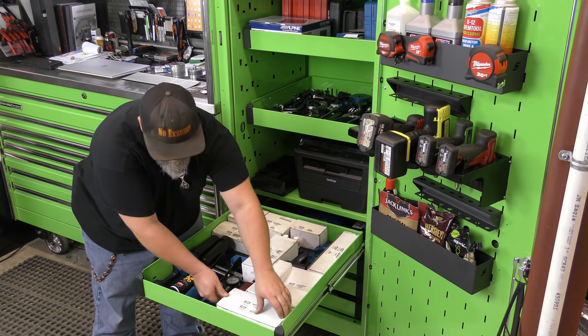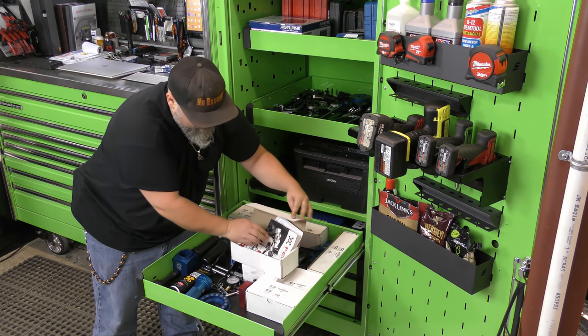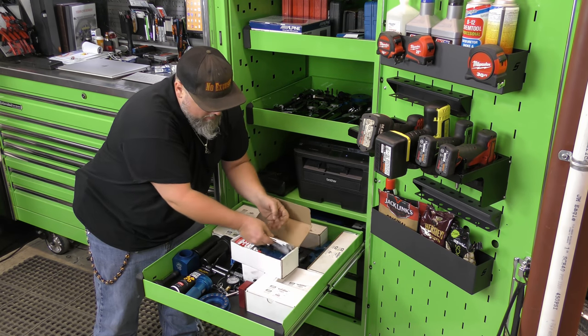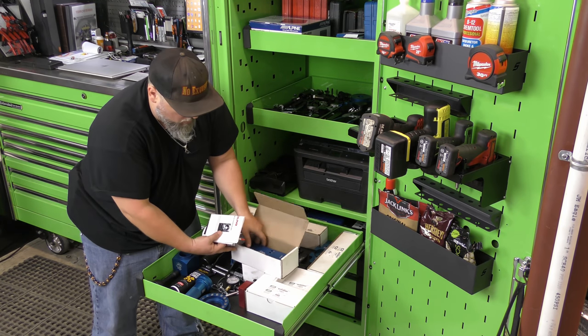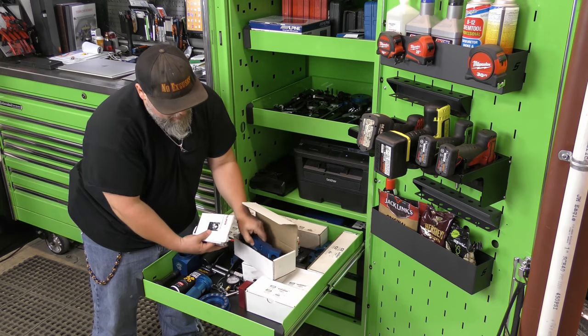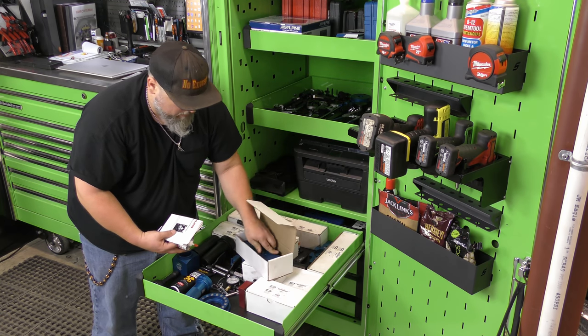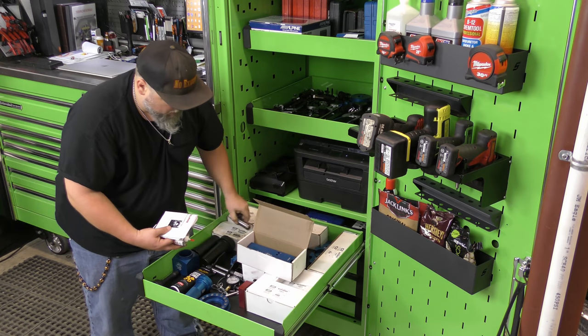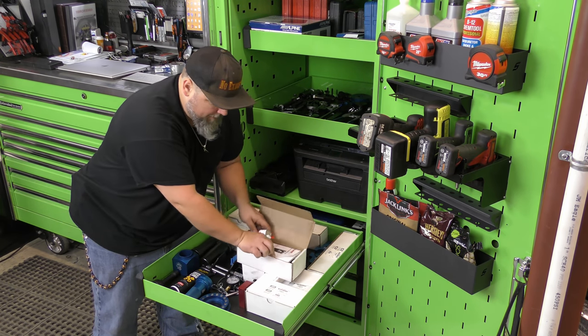This is a compression release kit. If you're installing compression releases and you don't have a jig, you will end up buying a whole lot of replacement parts when you tear them up. Jim's has knocked that out — it gives you a guide to make sure the compression releases are installed in the right spot so you're not marring up everything trying to drill it.